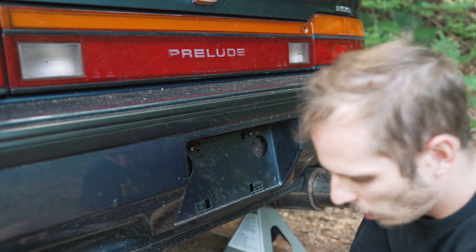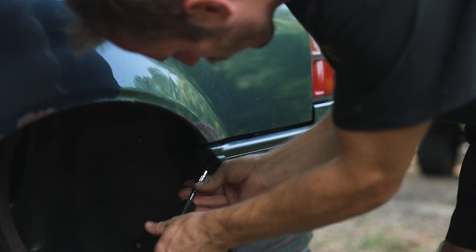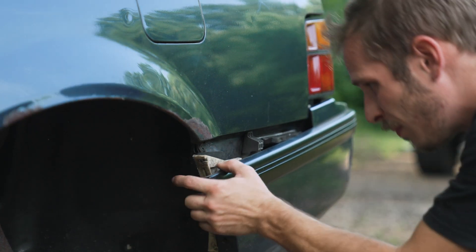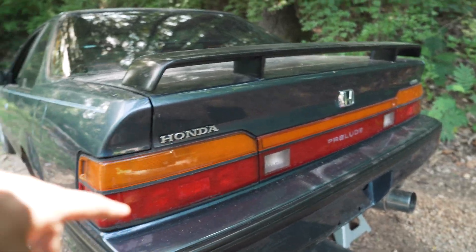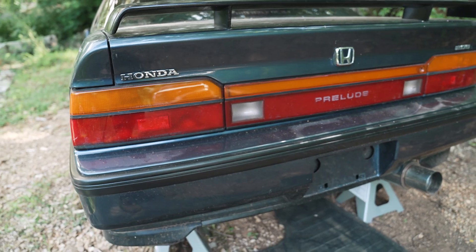There we go — I think it's about time to replace this setup anyway. It's been a good while since I've taken the rear bumper off on this thing, and I was honestly scratching my head, searching around with a flashlight to figure it out. I'm pretty confident the taillights need to come out first. There are bolts that go down along this whole thing, similar to the front bumper, but I think the taillights need to come out to get to those. After popping the trunk, I remembered these little nubs — there are two of them. I've got a fabricated trunk in here so yours probably looks different, but those two bolts might do the trick. I may not actually have to take off the taillights, which is a blessing.